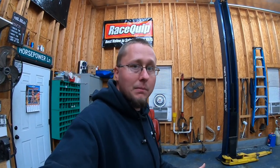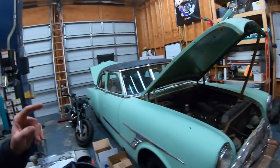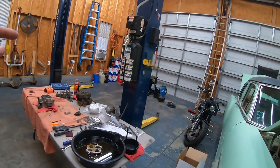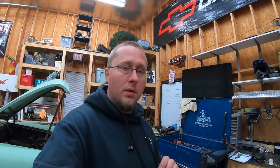I'm going to finish building this carburetor tonight — I'm not going to do a video on putting the choke on just because it's kind of boring. This is the first step in getting this thing running. I hope to have some time to rebuild the fuel pump this weekend. Then what I'm going to show you guys is running as few wires as possible to get it started — I'll put the ignition on a toggle switch, the starter on a button, hopefully get some fuel and spark to it so we can hear this thing run. After I change the oil, of course.